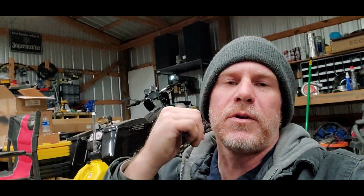The rear end is finally in the car. As you guys saw, we installed the spring, got the rear housing slid up into place, put in the U-bolts, got it all bolted up, went ahead and installed the CalTracs bars as well, and sealed and put the diff cover on. The rear end is now full of fluid. Also got the brake lines plumbed in.